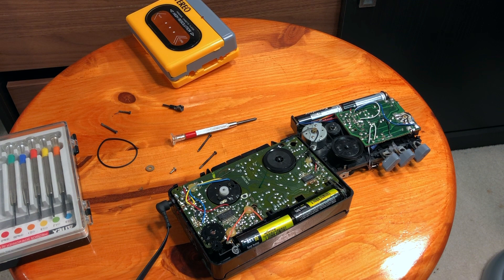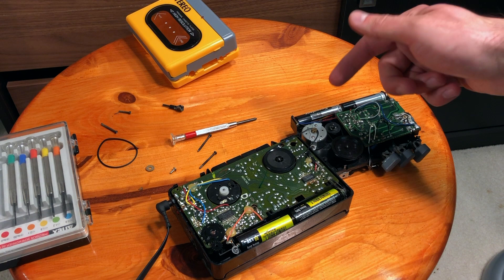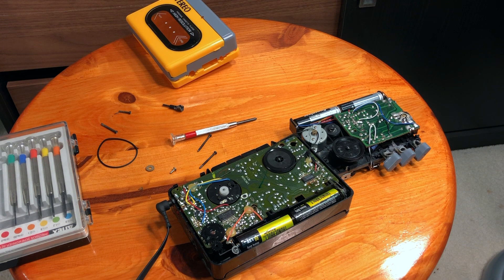The first thought you have is probably that something is wrong with the rubber — that's what I thought too. So I disassembled this unit and installed the rubber from another Walkman player, and basically no luck — it's the same thing. So then I came to realize that the problem is the motor.